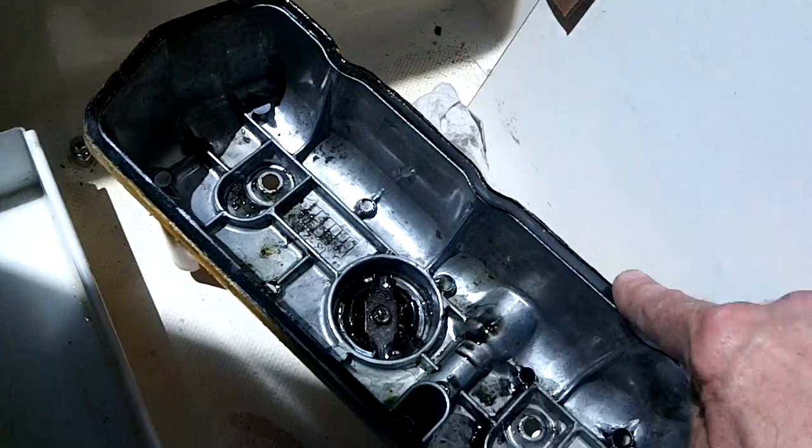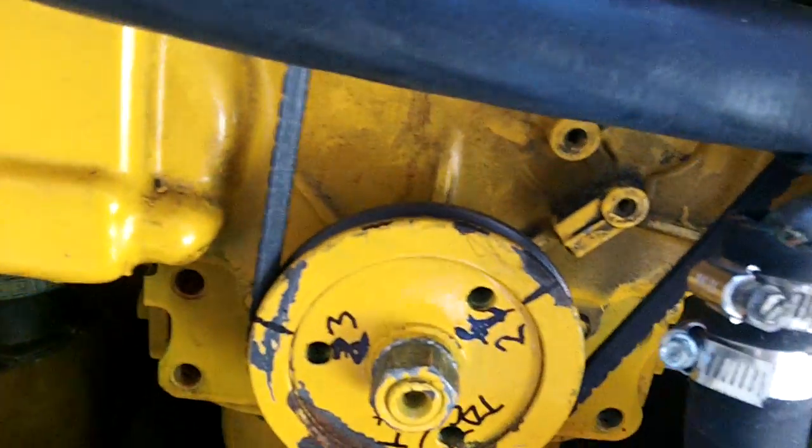While I have it out, look at this gasket and make sure everything's all right. Now looking at the engine, you can see the intake and exhaust valves. It's a three-cylinder engine, so there's an intake and exhaust valve for each of the three cylinders. The intake valve is the first one you see; the exhaust is the second. Because it's a three-cylinder engine, it rotates 240 degrees before you get the full dead center compression stroke for each cylinder.